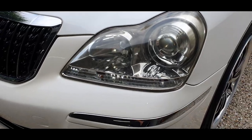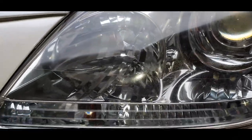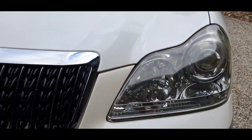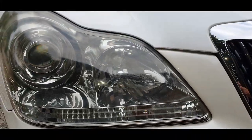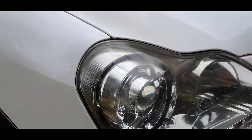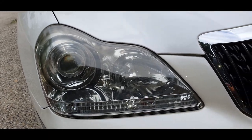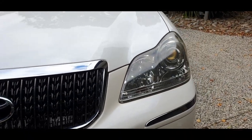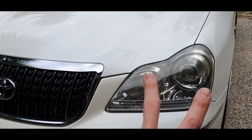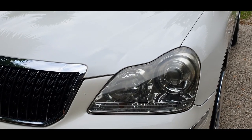Okay so it's kind of hard to see at the moment how average it is, but if I get nice and close you can see all that marking on it. I want to get it all off, get it nice and polished up — and it's literally across the whole thing. Because it's not in crazy bad condition, I'm going to use 2000 grit wet and dry, sand it all back, get it nice and evenly clouded, then compound, polish, and wax — same as I did on the Supra lens.